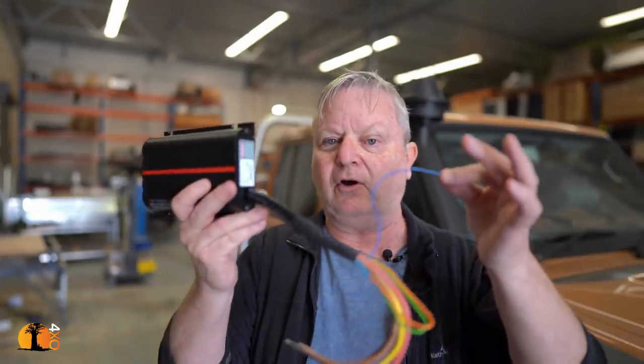DC to DC chargers — many of them have trigger cables. The blue one on the red arc is designed for smart alternators, but not all vehicles have smart alternators. The Land Cruiser does not have one, fortunately, because it just complicates things. But this can also be used as a trigger cable — for example, if I wired it to my ignition switch, when the ignition is on the circuits are on, when it's off they're off, which to some degree protects the start battery. However there's a big danger: if you leave the ignition on accidentally, a 50 amp charger is going to drain your start battery at 50 amps even if your engine is not running. Within an hour you're going to have a flat start battery — something you really want to avoid. So be very careful if you decide to use the trigger cable on your installation.